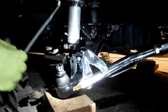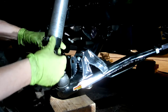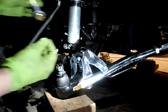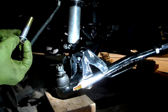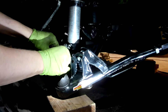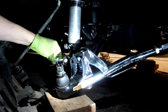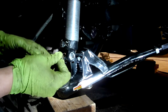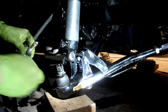This is where the coilover assembly mounts, which is a little tricky. It has a heim joint here — a rotational bearing. As it slips into this brace, there's a bolt that goes through that mounts it, but there's a shim or spacer that goes on either side inside that brace. You have the washer on the outside of the brace, but you've got to get the shim on the inside of the bolt as you go through, then slide it through the spherical bearing — the heim joint of that coilover mount. As you can see, it's a little tricky to get it all lined up.